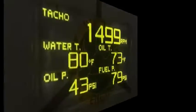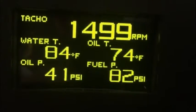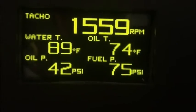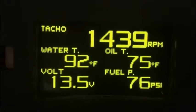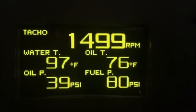We're going to finish up by having Jan tell us a little about the Viking display and the advantages of the Viking View in general. Here's your Viking View running — you've got your tachometer on the upper right, coolant temperature, oil temperature, oil pressure, and fuel pressure. You've also got a low voltage warning. If the alternator were to fail, the voltage would drop and you would get a voltage warning in the bottom left corner. Turning the alternator back on, you can see the voltage warning goes away and the instrument returns to displaying the basic and necessary items required to monitor your engine. Each field will turn yellow if one of the parameters has been exceeded.